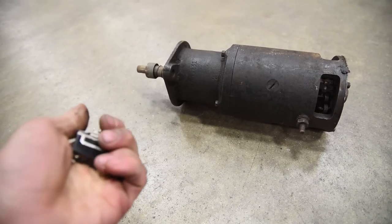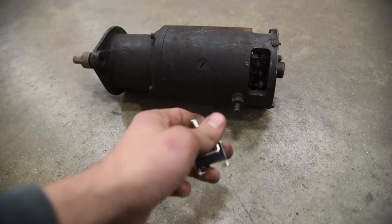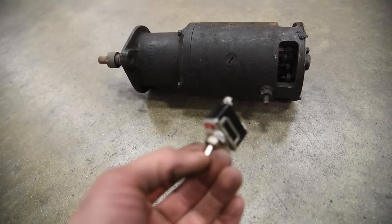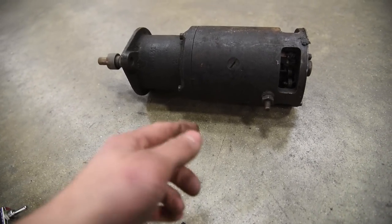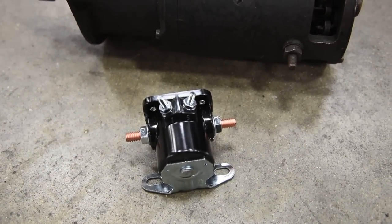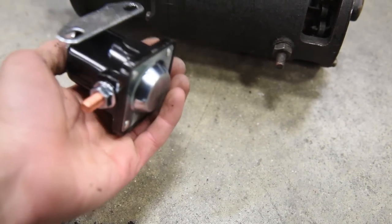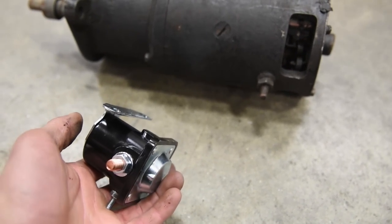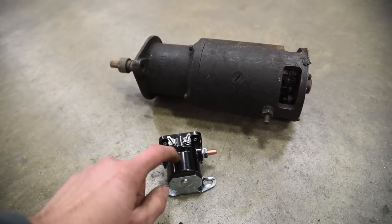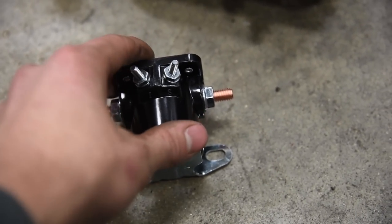Playing with these little switches for lights and miscellaneous parts, you might be wondering: how the heck do I make a starter work off a tiny switch like this? The answer is, you don't. You don't use a switch like this to turn your starter on and off. That is where a starter solenoid comes in. A solenoid is basically just a gigantic switch — it's absolutely massive because it's meant to take pretty much all the power of your battery going through it to activate the starter.